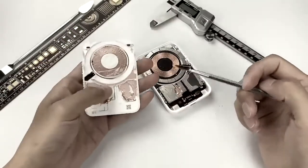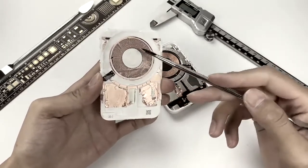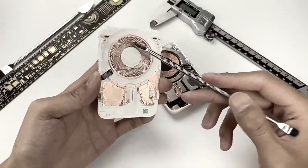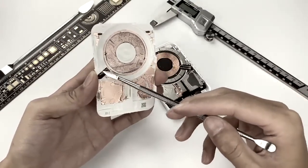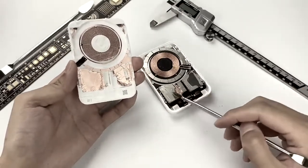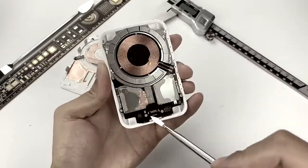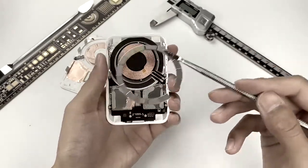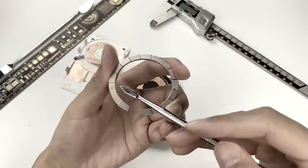The product has been opened. Let's take a look at the upper cover first. There are two coils attached to this cover. The large inner circle is capacitive sensing, used to detect the distance between the phone and battery. The outer circle is an NFC detection coil and is connected to an NFC chip. The bottom part is covered with copper foil and there are two shields under it, used to enhance heat dissipation. The whole module is fixed on the shell with eight screws. The magnet ring around the upper coil is not glued and fixed, so it can be removed directly — it consists of 16 small magnets.